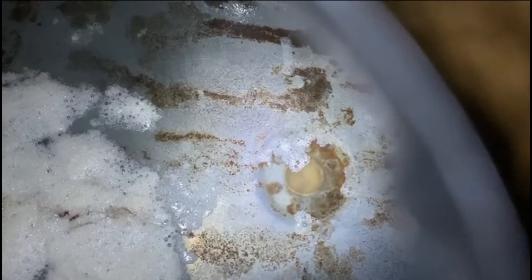I've just finished the rust conversion process and as you can see it's definitely worked - the tank is pretty spotless actually. That remaining rust is just surface rust, a bit of remnants, not very thick. They say to rinse it with warm water so I'm going to tip some warm water in and give it a rinse. You're not going to actually get rid of that surface rust entirely unfortunately, but even as it is it's a pretty clean tank - I'd be happy to put fuel in it as is.